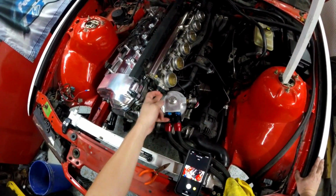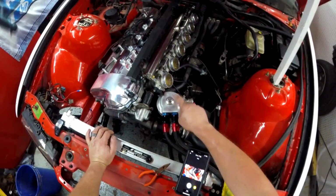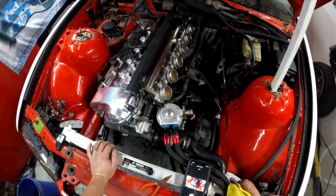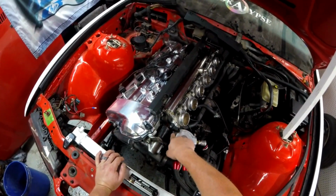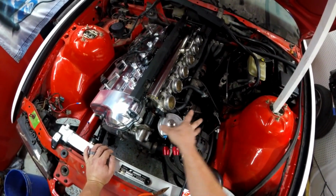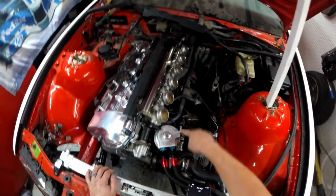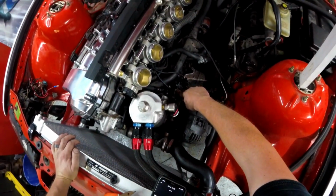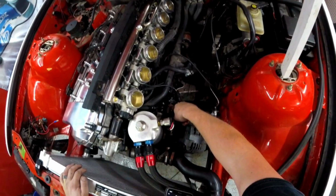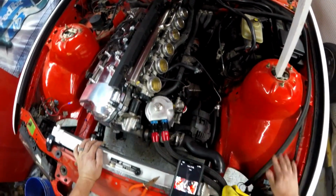We still haven't figured out our oil cap issue with our TPS sensor. What I'm going to do is, for the time being, so I can get this all bolted up, I'm going to take this cap off. I'm going to run the OEM cap, set this cap off to the side, get everything put on, and then we'll figure out, because the intake manifold comes here and interferes with the sensor, so this whole thing has to rotate anyways. But I want to make sure that if this rotates, there's enough room, because if not, we're gonna have to move that down to here, and we'll run like the Rally Road adapter down here that tees off, and we'll run this down here and then plug this up here if we can still run this cap.